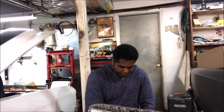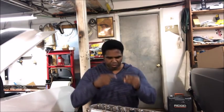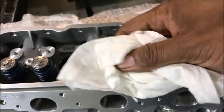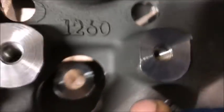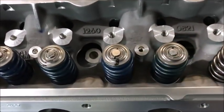In order to change the springs and seals, I have to get a tool — I've got this spring compressor tool that I've had for many years. This is pretty much any spring compressor; it works on the same principle. We're going to concentrate on these two right here. What I usually do is take a piece of paper towel, balled up, a couple pieces, and put it in the back of the heads like this — right here. This is going to hold the valves in the closed position.